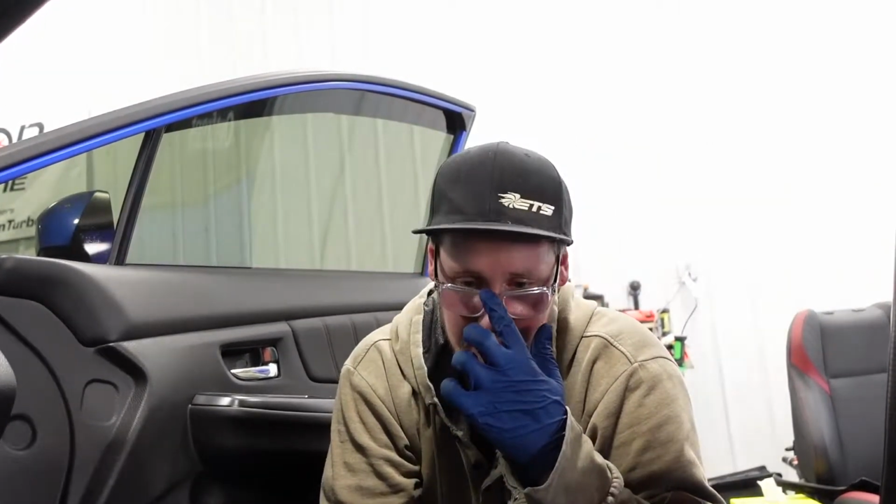I'll go back to the calipers, and at least we learned we don't have to take the wheels off to bleed the brakes with your little fancy tool there. Well, yeah, luckily Brembos are accessible that way. I know that Brembos have two bleeding ports, one on the front and one on the back of the caliper. So we're just using the front, which should be sufficient.